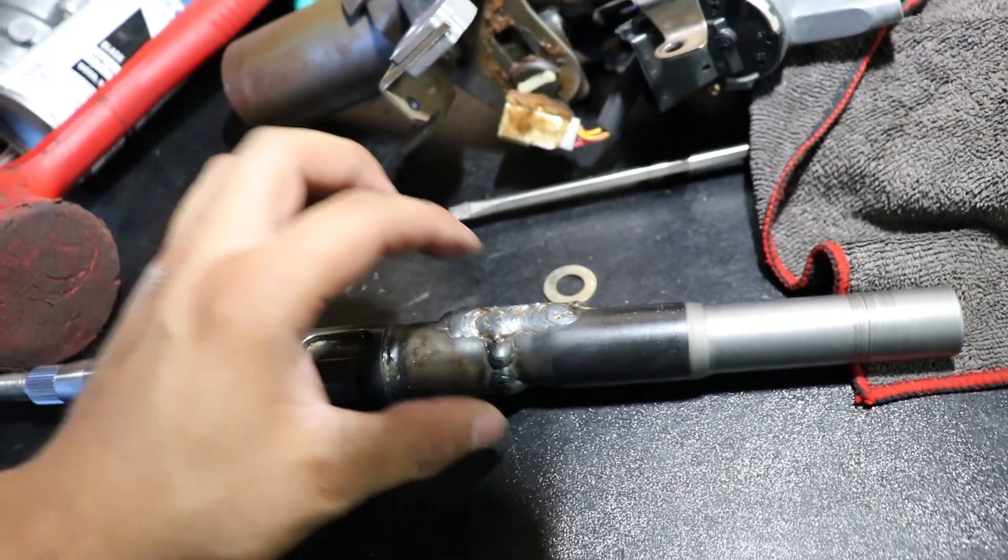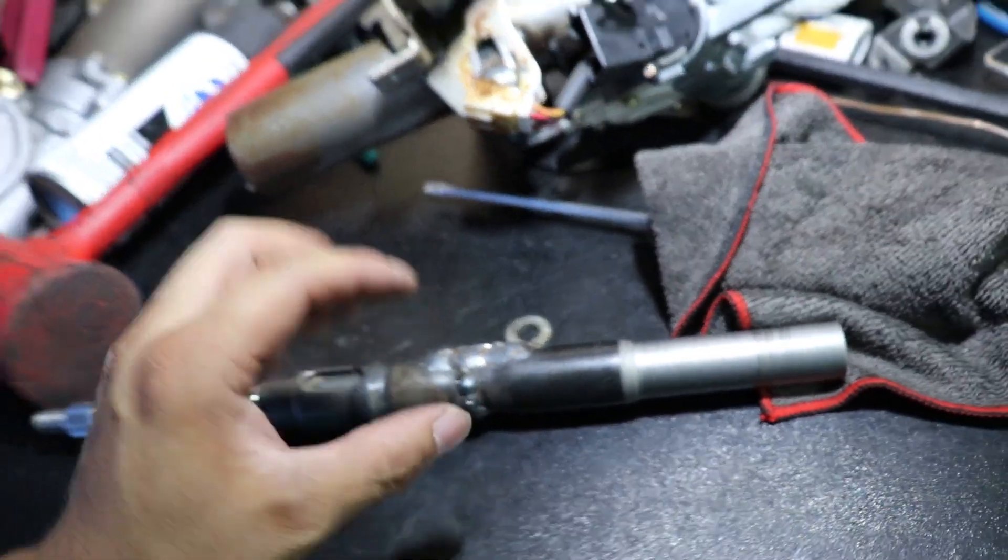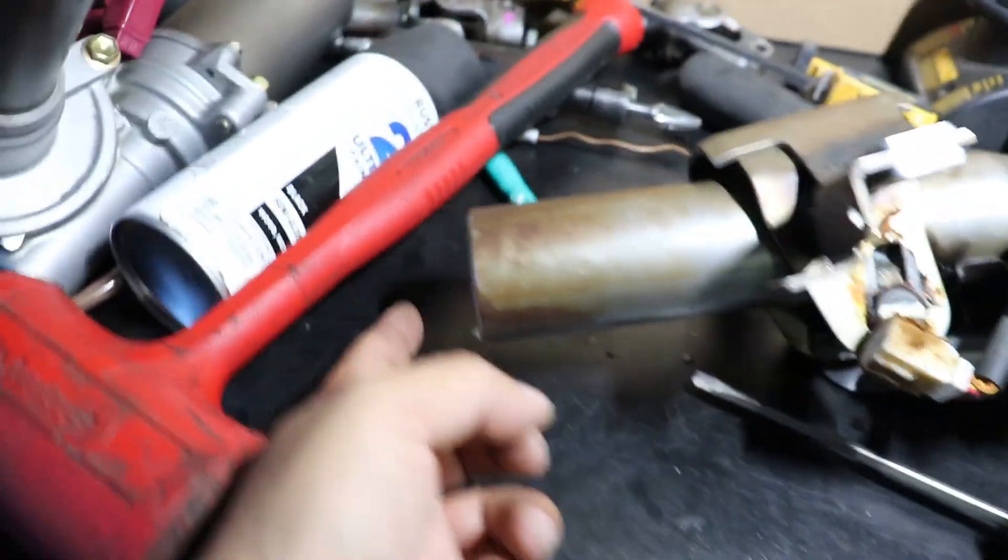It's getting a little dark out here. You've only got one and a half inches of play between this and the other edge because we have one and a half inches inside here, so you can't make the welds too thick — don't make them look like a hippo because they're not going to fit inside here.